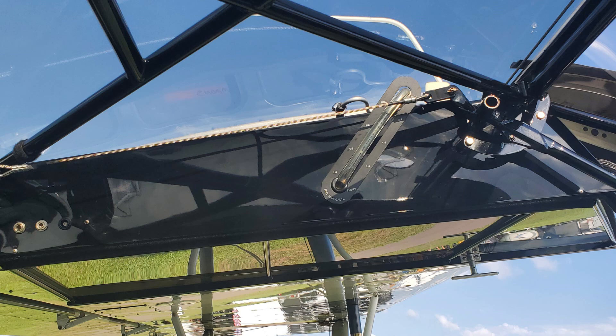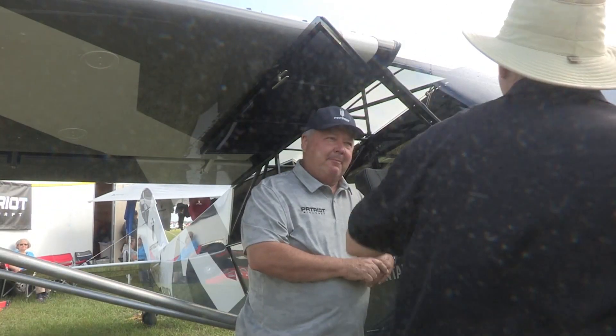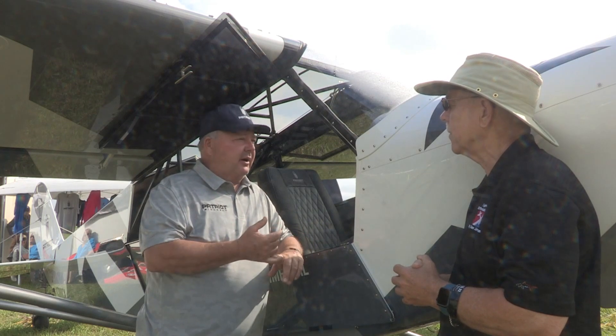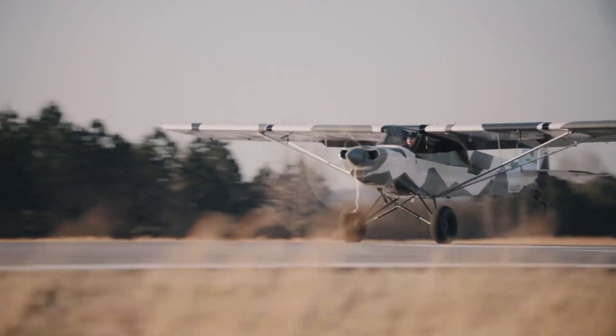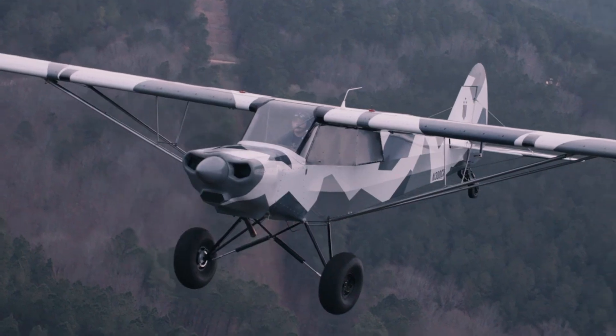You must have tanks on both sides. Yes — two 18-gallon tanks, one on each side of the airplane. It's definitely a pretty tall airplane — I'm about 5'10" and this is well above my head. The engine is a Lycoming IO-320. It's got a cold air induction system, 9-to-1 compression ratio pistons, and E-MAG ignition. That combination gives us a lighter motor, and the ground-adjustable propeller is lighter too, which really makes a difference in performance and wing loading.